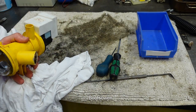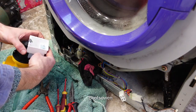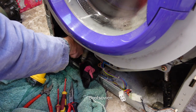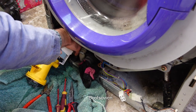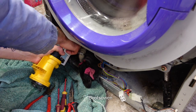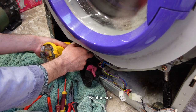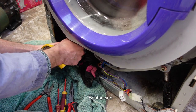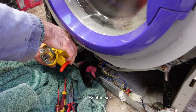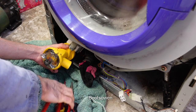I'll reinstall it and I'll do another wash, but that's pretty much it for this video. So let's attempt to reinstall this pump. Live and neutral go the appropriate way up. I don't actually know that it matters which way around these things go. I'll put that in a bit further and then we'll get this hose on. I'll just wiggle it into position, push it down as far as it'll go. And then get the clamp, drop it down. There we go.